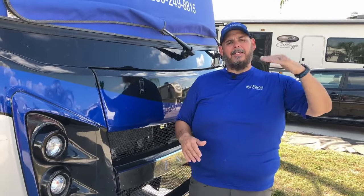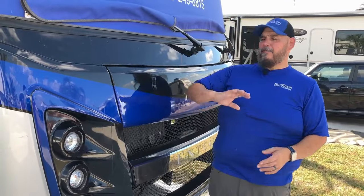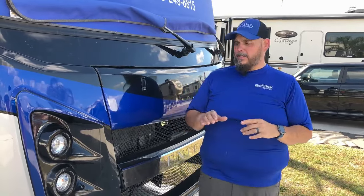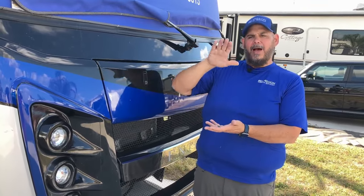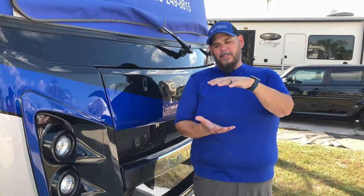Level doesn't exactly mean stabilization. We're in our Florida location for the winter in Bushnell, Florida. We're on a pad, which sounds great, but this pad has a steep grade for an RV. On a 40-foot Class A motor coach we're pretty steep going backwards, so the rear jacks are really extended. When jacks get so high, you get a sway — they're just too far extended. We've put blocks under our snap pads to minimize that jack travel.